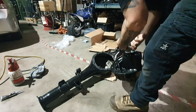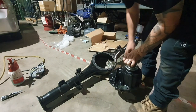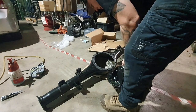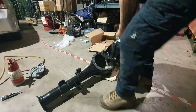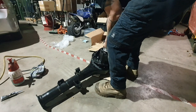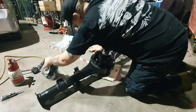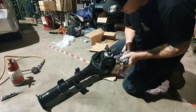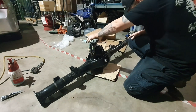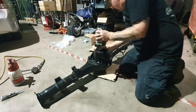I've got a smear on the face on the backside of the main centre and a good lathering on the housing. Remember, the drain bung is to the bottom and the spring perch is at the top. We can drop her in — not the easiest thing to drop in. Bam! That is fantastic — it just went straight home. There's a little bit of squish on our sealant all the way around.